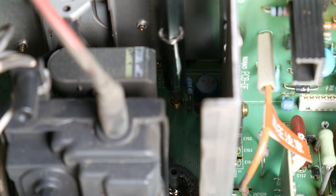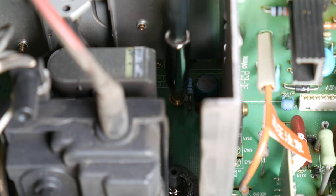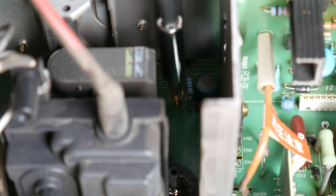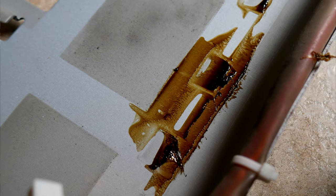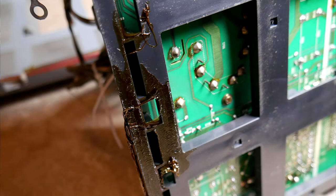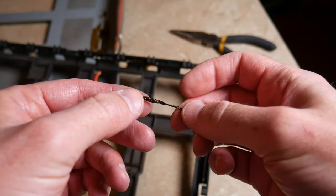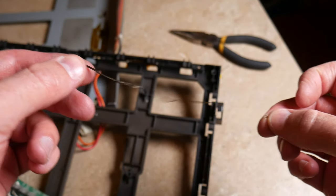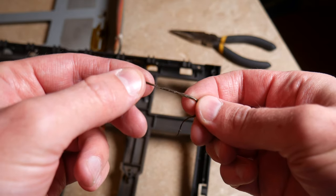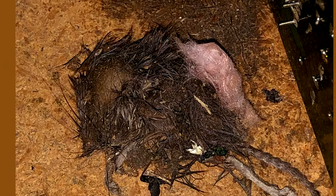After I got the chassis out of the arcade cabinet, I actually had an issue where I thought I was missing a screw. I thought I had to have missed taking a screw off of the board that was attaching it to this metal mounting plate inside the cabinet, but no — that was actually just the amount of the black goop that was underneath the chassis, working in a glue-like fashion holding it to the board. So I had to get a hairdryer and heat this whole thing up and then pull it apart. It was a little messy, but also not the worst thing I've encountered as far as arcades go.